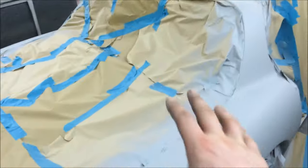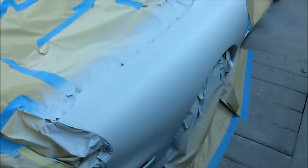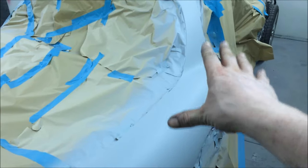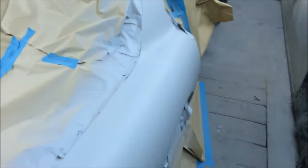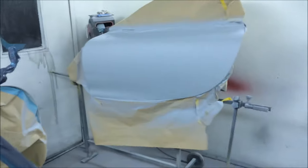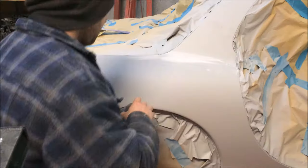The RX7 has had the first stage of painting done now, where we've laid a coat of epoxy, and this is EverCoat Slick Sand, which is a polyester. So we've done the rear quarters and we've done the doors, and now we're going to block it to within an inch of its life and get these panels dead straight, and if it needs another few coats applying, we'll apply another few coats.